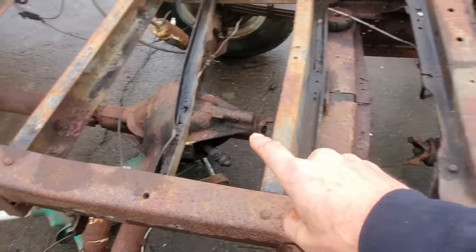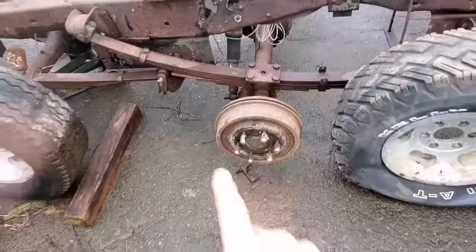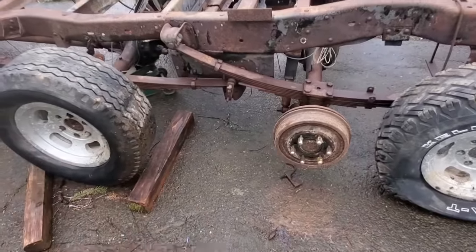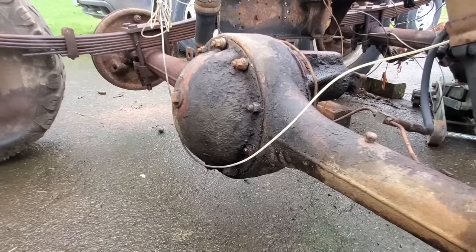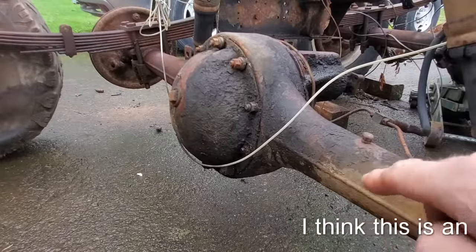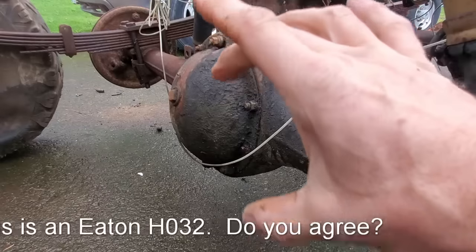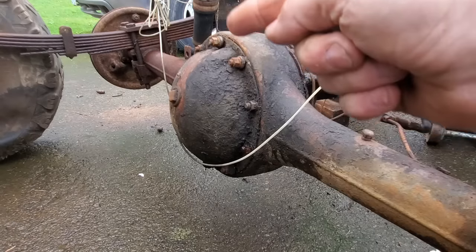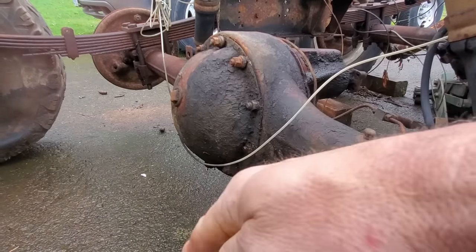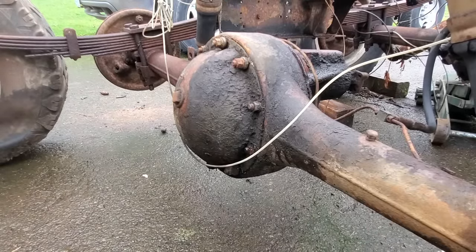Drive shaft in, pinion out, goes to this rear end, drives this, and let's see if everything spins the same direction like it's supposed to. Okay, so this is a more common view of a rear end, things we're more accustomed to. You'll see the axle housing. In this case, it's called a banjo style housing, because you see the circle. And then you've got this cover that's bolted on here. If I take all those bolts off and I drop this differential cover, it will expose the gears inside there and all the inner workings.